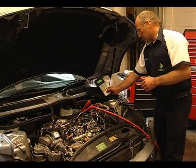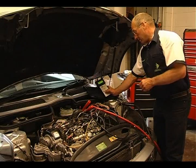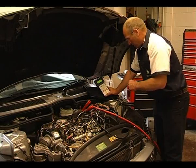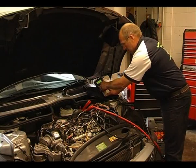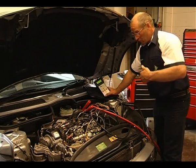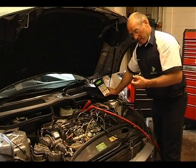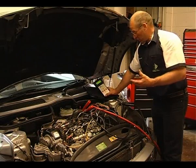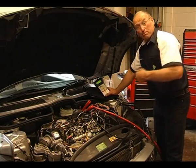Let me select that first. This should prevent us from running the engine - it says 'do not start motor, to activate press start.' So we now have a situation where before we had a cranking pressure of 300 bar, and it's now telling us we have a theoretical pressure capability of 700 bar. We've doubled the pressure generation from the pump. The point of this test is to prove the pump doesn't just build up 300 bar, but can actually go to double that pressure because we now have direct control of the escape route - the pressure regulation. It's a proof test.